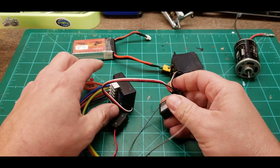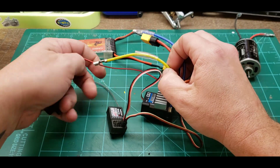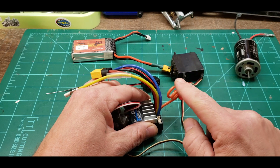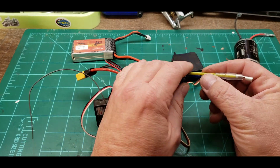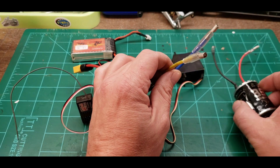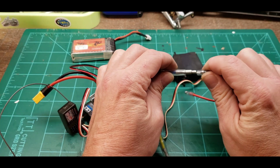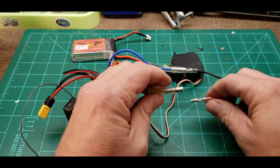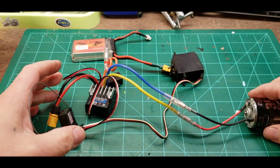Now you have these motor leads that come off of here. This is a Tamiya ESC, and the thing with Tamiya ESCs is they are brushed and brushless compatible. You'll have that orange wire — if you're using one of those, just coil it up and set it aside if you're doing a brushed setup. They're going to give you a yellow and a blue; sometimes these will be black and red, or green and yellow, or any other color. The darker color is going to be your negative. No worries if you put this in backwards — it's not going to hurt a thing, it's just going to make your motor run the opposite direction. Plug the yellow into the red.